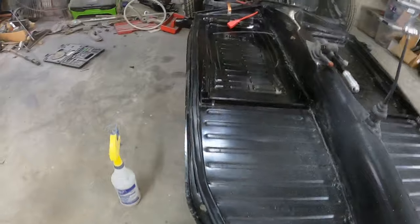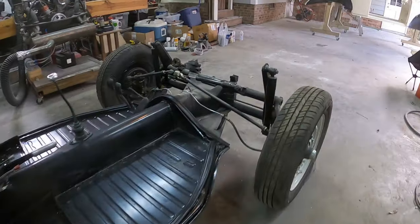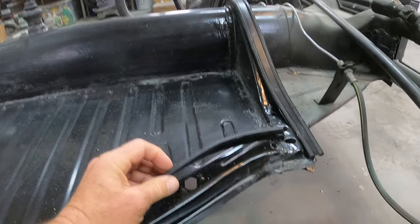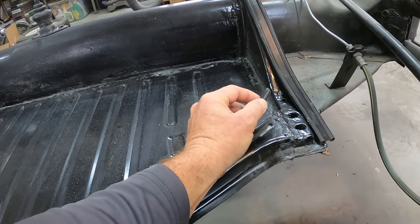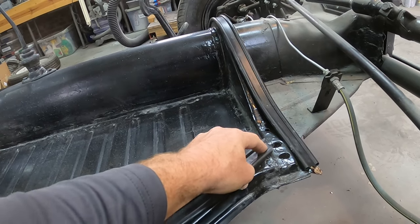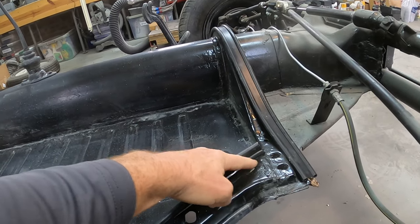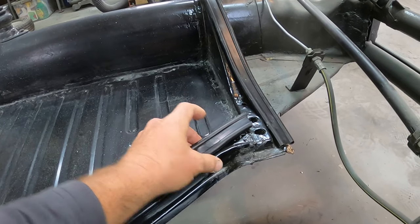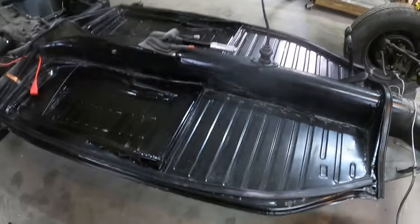I cleaned off the chassis. What I've heard is that people take an exacto knife and make a little X right where each of the holes is, so that's what I'll do. But I also want to put a few little dabs of some kind of glue, seam sealer, or caulk which will dab into these little divots, and then I'll clamp this down so it's fixed in place - otherwise I'm afraid when I lower the body it'll move the seal out of the way.